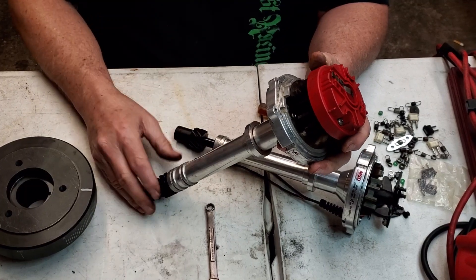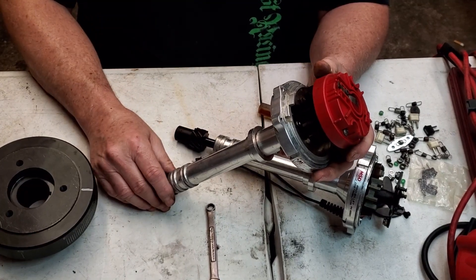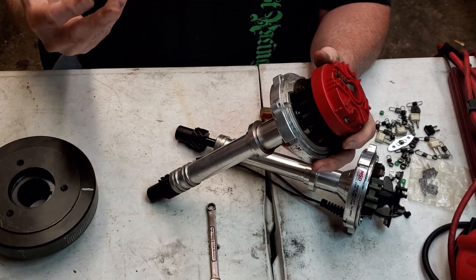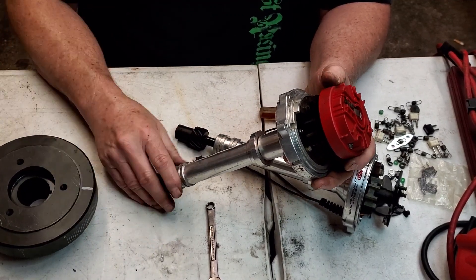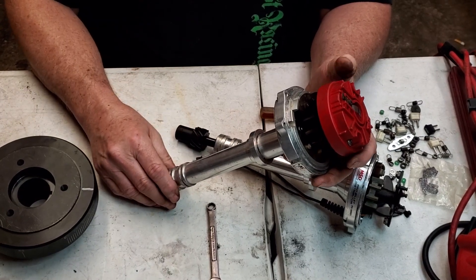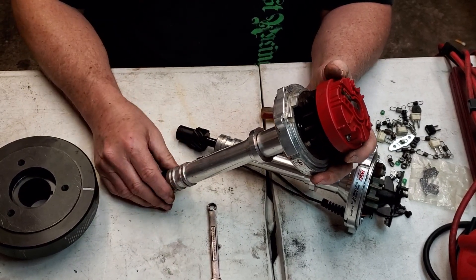Keep the idle up to a thousand minimum — I mean 1200 to 1300 popping in gear. If it stays up there a thousand you've got a good converter, that's what you want. When you do this to that car, it's going to be like somebody just ran into the back of you at 60 miles when you take off — it's going to snatch your head back. It's going to have twice the acceleration out of the hole. It makes an absolute performance advantage, but running this on the street you're running too much timing all the time — it will probably put premature wear on the motor.